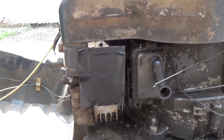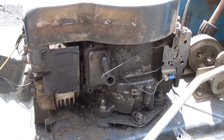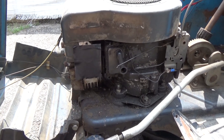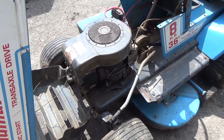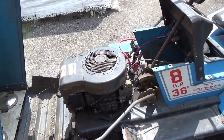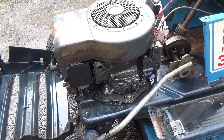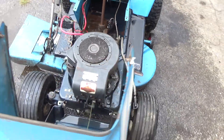I've got a piece of tape over the intake and exhaust port. Before putting the carb back on, now that it's cleaned and the fuel tank has had a chance to dry, I'm going to hit this with degreaser on both sides of the engine bay and then pressure wash it to get all that grease off the engine. That five minutes of washing got all the grease off.